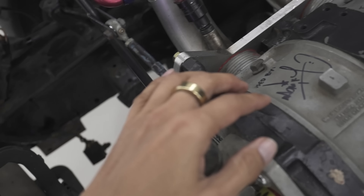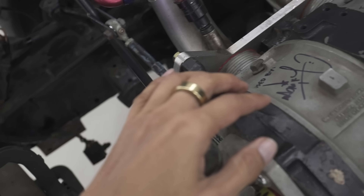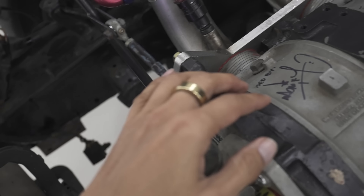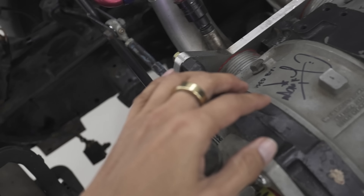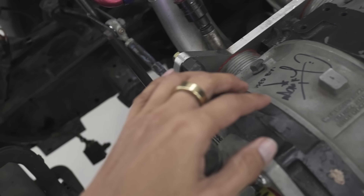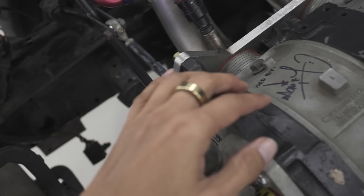As you can see, this is the center line for the car, and if you notice the engine is actually off to the side a little. It's because the headers and the intake are bumping some parts of the chassis. Mad Mike said the whole engine is offset — I just don't know how many inches it is offset to the left or the driver's side. We also have an issue with the collector and the long tube headers, which are really low and we're going to end up losing that. Instead of getting the car running and then seeing what the problem is, we're actually just going to fix it. Basically that has to go into the chassis or at least higher than it is now, and we may have to change this to a bigger exhaust pipe — I'm going to measure everything.